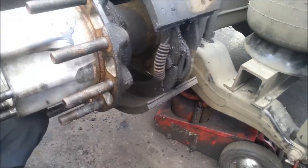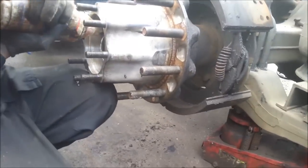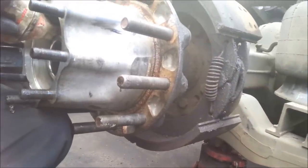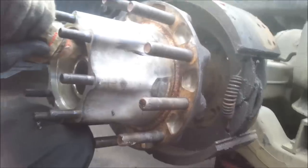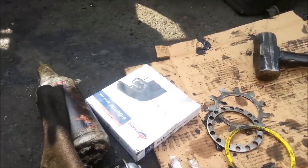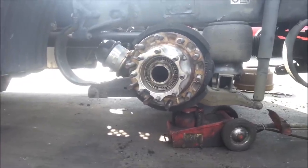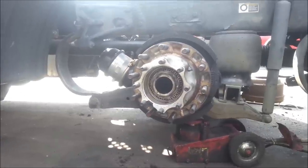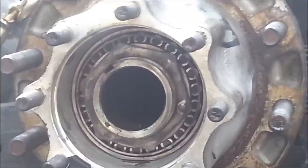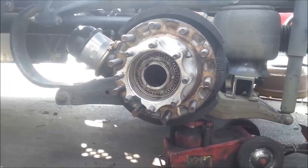The seal is in. We've got the grease-coated bearing in and we're putting the washers on. As you can see, it looks pretty good — all the grease and all that dirt is off. We've got a brand new seal in, and we're going to go check the second one on the rear right.